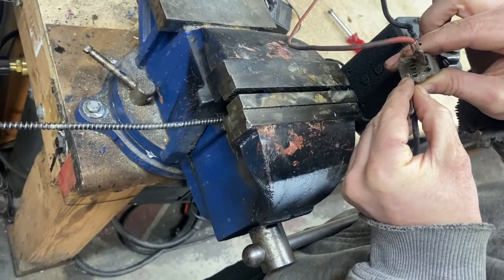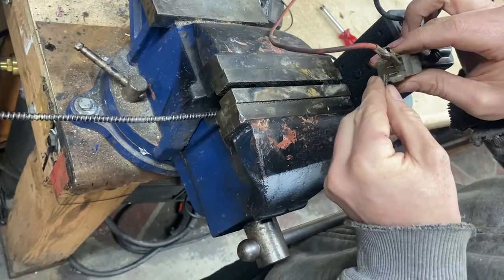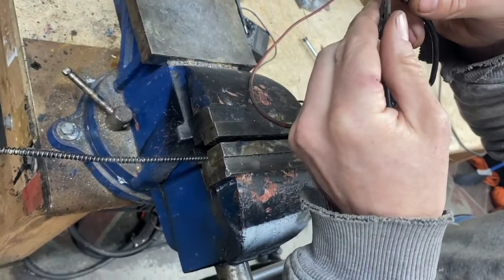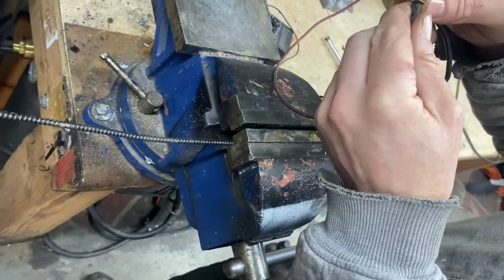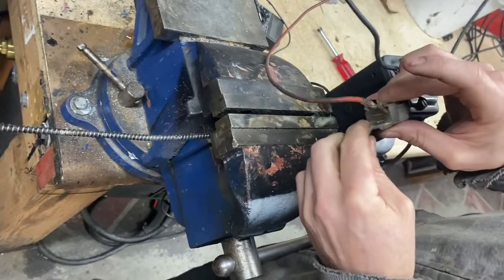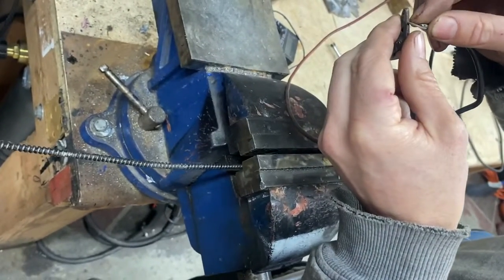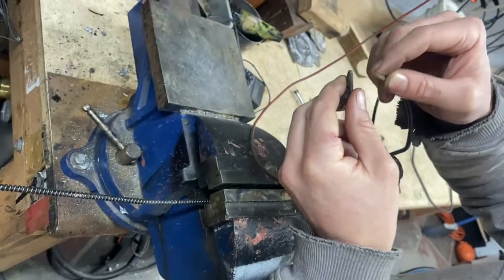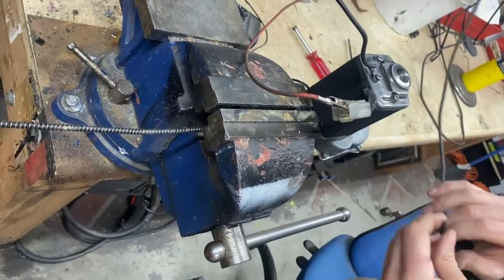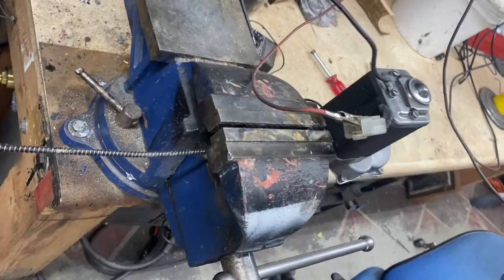And now, if you just leave it in some position that is not at either end, we're going to do the park circuit, which we adjusted. All the way in — after reinterpreting the position of the wipers on the car, the park position, the wheel boxes — by keeping the park wire grounded, it does automatically park on the passenger side in this particular car.